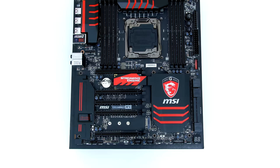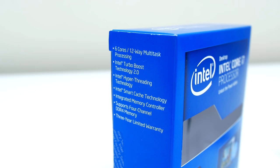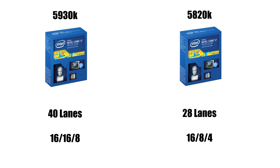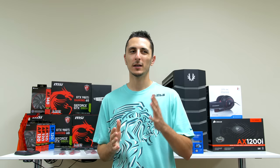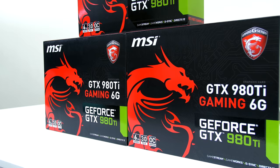Those are just some of the awesome features that the MSI Gaming 9 motherboard comes with, and the fact that it's in black and red made this a simple choice. For the CPU, I went with the 5820K. A lot of you might ask why I didn't go with the 5930K or the 5960X. The simple answer is price per performance — since most games don't support over six cores, going with the 8-core 5960X would be wasteful. The 5930K has 40 lanes giving a 16-16-8 configuration in three-way SLI, versus the 5820K's 16-8-4, but the performance difference is marginal. Since this is strictly a gaming PC, the 5820K made more sense.